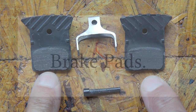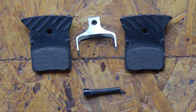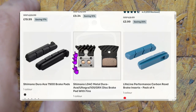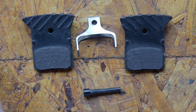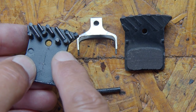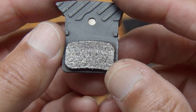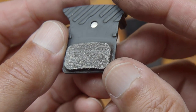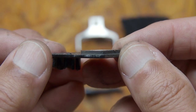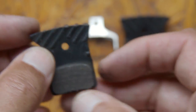These are the brake pads supplied with the Z-Race brake calipers. In terms of form and function they're effectively the same as the Shimano ones I had on my Ultegra brake set — indeed you could just buy Shimano brake pads and fit them into these calipers. Although the calipers were quite cheap, the brake pads don't seem to be cheaply manufactured. They have small cooling fins on the top, just like the Shimano ones, and zooming in you can see the brake pad material is a metallic sintered variety. After about 3,000km of use they're probably about one third worn, so they're not lasting too badly. The metallic pads will likely lead to more disc wear though.